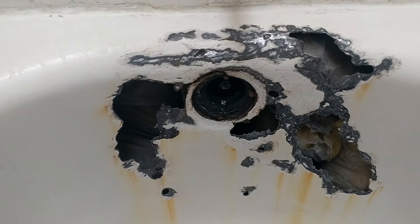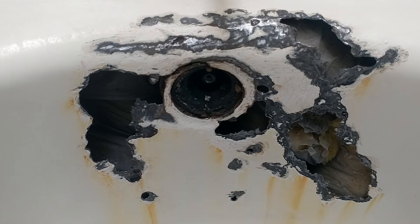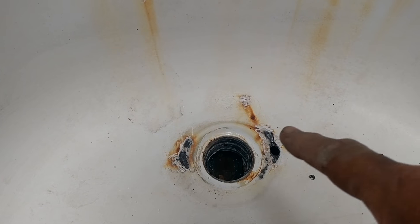As you could tell by the thumbnail, there was a little bit of rust on it, but after we cut it away it's like swiss cheese — the metal gets really soft underneath. You have to cut all that soft stuff out. The purpose of this video is to show you how to fix these instead of having to rip them all the way out. For any tub glazers watching, this is my technique; if you have a better one, share it.